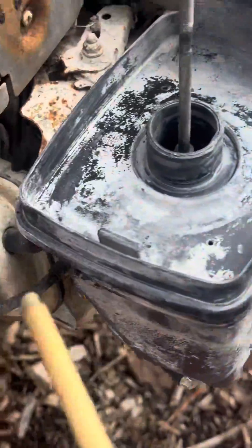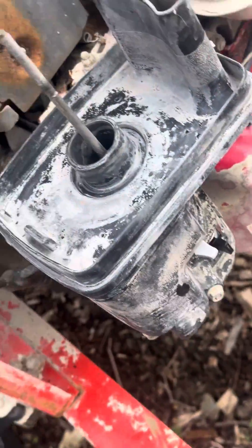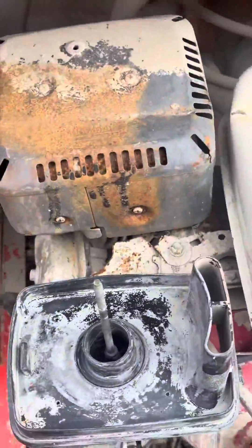Now that cleans it out. When you pull the pull cord, the piston moves and that'll push everything out. If it's flooded and you're standing back, it's gonna shoot oil and water about 20 feet — it's gonna go far.